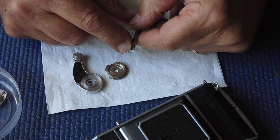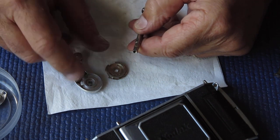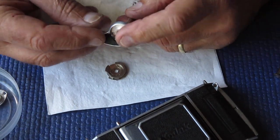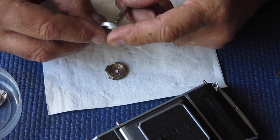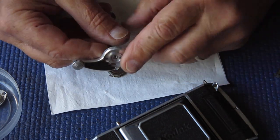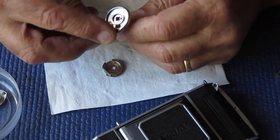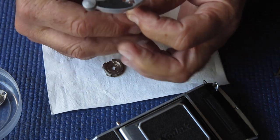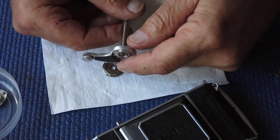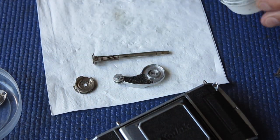So if the shaft breaks, that's where it's going to break. Likewise, if a camera has been dropped on its head at any stage, you can find that this shaft is bent. If it's been dropped and the film advance lever strikes the ground first, it can push over and bend the shaft. In which case you'll probably notice, looking from the top of the camera, that the lever doesn't swing through a smooth arc — it might wobble up and wobble back down again, even scuffing the top plate. But this looks good enough to use, so we're using it.